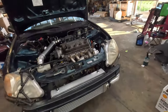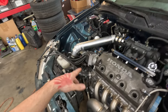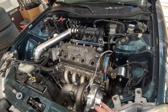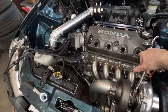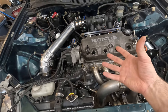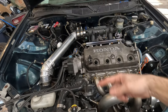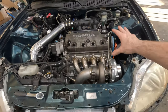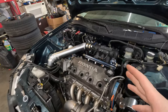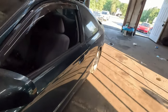All right, for fresh rebuilt motors like this one, what I really like to do is obviously don't start it right away. I need to get lubrication. We need to prime with oil. So I unplug the distributor like normal. I unplug the injectors like normal, but I also take out the spark plugs. This allows for free compression, so there's no compression that would push the piston and the rod bearing down on the crank. So what we want is the free float, basically get oil pressure, and then we can have compression by putting the spark plugs in. So I have those out already, so we're going to crank it until we see oil pressure on the oil pressure gauge, and we'll see how this goes.